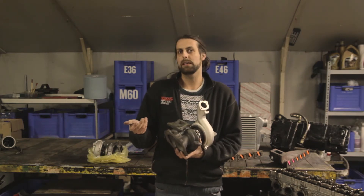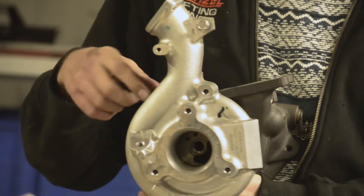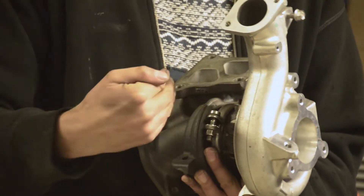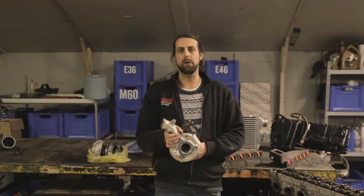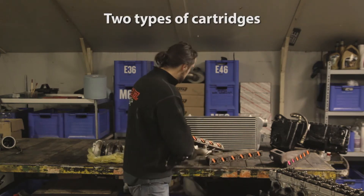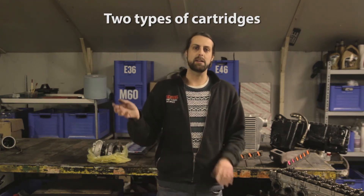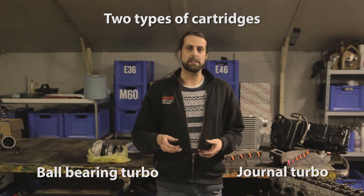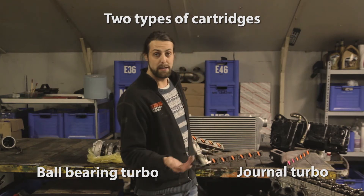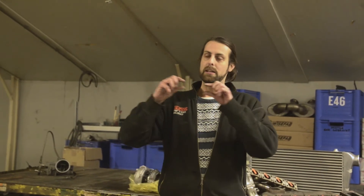The bearings are very high quality. There are basically two types: the bearing that controls the axial motion of the turbo shaft, and the bearing that stabilizes it radially. You can put turbos into two categories: ball bearing turbos and journal turbos. A ball bearing turbo has a ball bearing in the cartridge, while a journal turbo has the shaft floating on oil — just like your crankshaft or camshaft — which is the standard type.